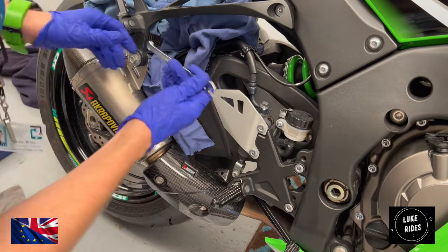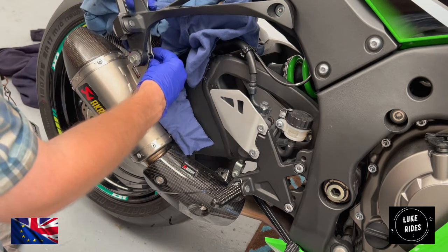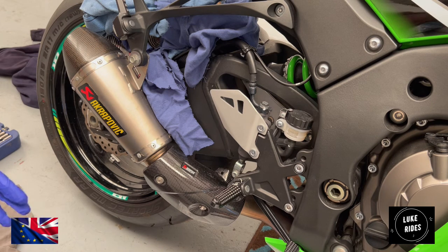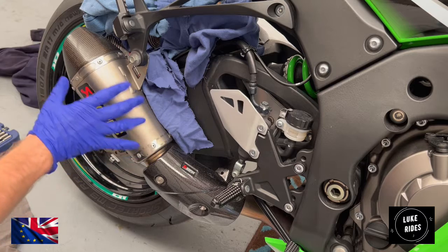because when the titanium gets hot and there is still oil from your hands on the titanium, it will then have oil burn marks in the titanium. Once that happens, the problem is there's no going back. If the titanium has burn marks in it, you can't sand it out, polish it out, buff it out, or scratch it out. It becomes part of the titanium forever.